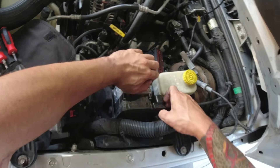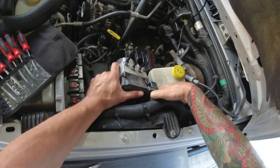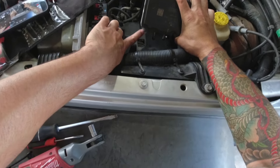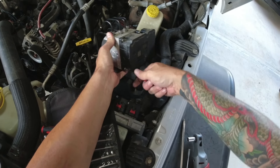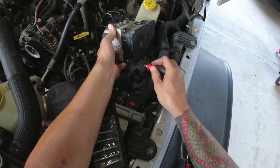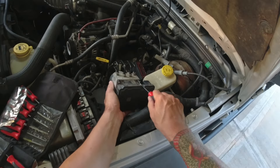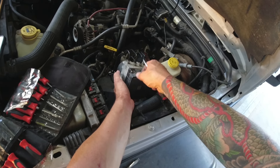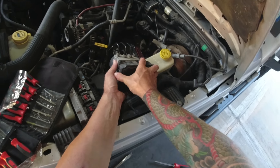It can be a little stubborn. I'll show you exactly what it looks like once we get it up — hopefully you can see these little rubber grommets and the pins that are holding it in. Now it's just going to be four torx bolts right here. The bottom ones are harder to get to, so go after those first and break these guys loose.